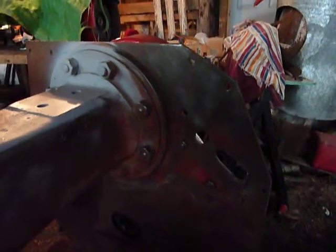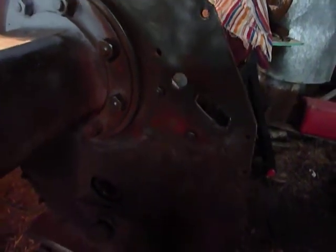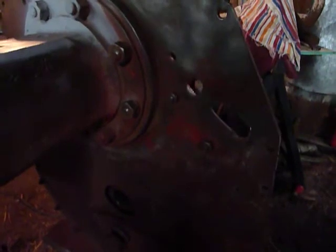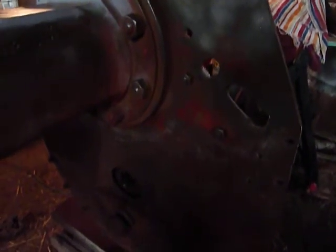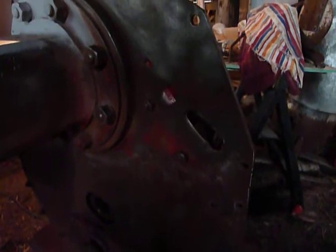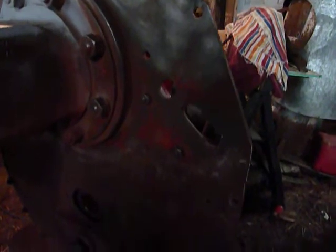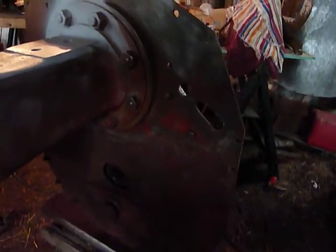I've kind of stopped right here - anything below that is still dirty, and then anything on that side is still dirty. I've taken it down to semi bare metal. I'm not going to worry about a little bit of this paint. This whole area was paint before I started and it was kind of rough, had been coated several times, but it's smooth enough now and blended in where I can clean it up and paint it.